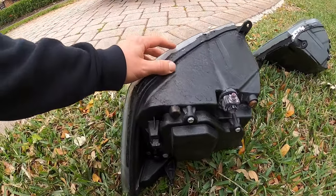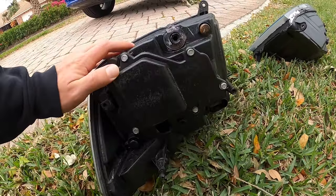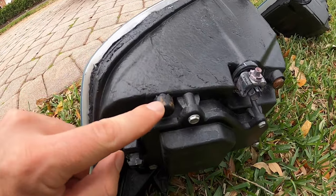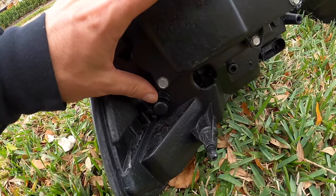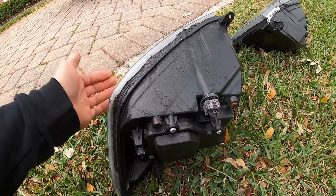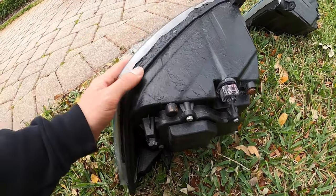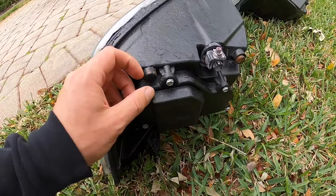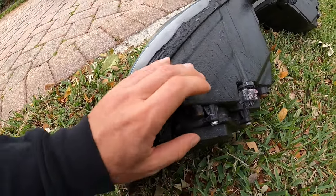What I researched was actually something completely opposite to what you might think. Rather than trying to keep everything sealed off, it's actually these three vents. There was a Technical Service Bulletin on these headlights. These caps on the back — this one has been painted over but it's supposed to be brown — this cap, this cap, and this cap pushed in far back here: these are all vents for the headlight. When you operate the headlights, they heat up inside and there's a different temperature outside, and it forms condensation. If they cannot breathe and let any of this escape, you get all this water formation.